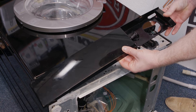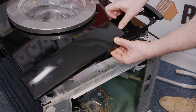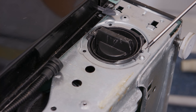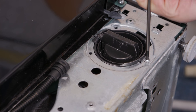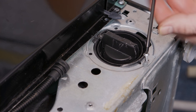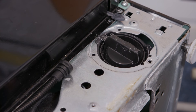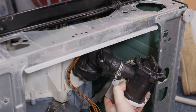Shift the kick plate to the right and remove. Once you remove the kick panel, just take out the emergency drain hose. There's one more Torx head screw holding the pump chamber on here — take it out and then tilt the pump chamber back to release and pull it out to access the drain hose.